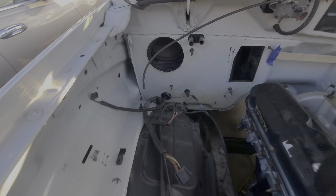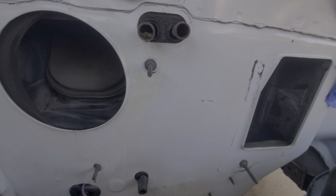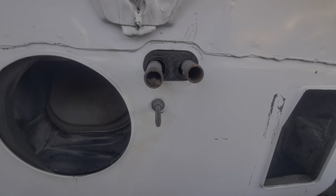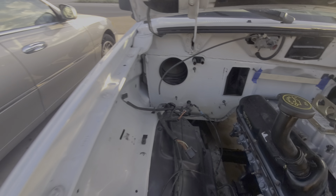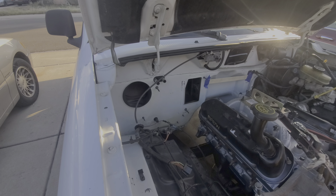For folks wondering why their heater core or heater is not working — odds are you've got something like that in there. What's nice is on these trucks it's four bolts and you can drop out the heater core inside the truck. You don't need to remove the dash.